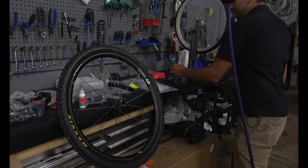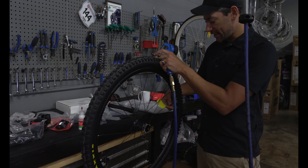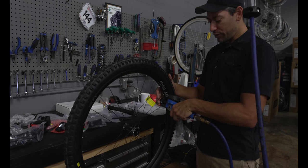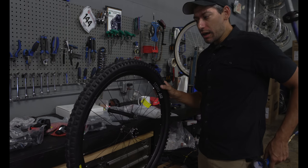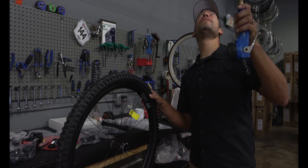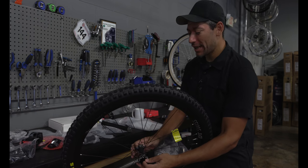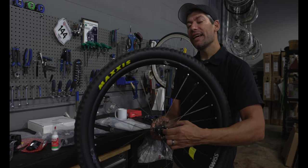And I will probably take this up to about 40 PSI, just so that things settle into place. And we let it sit at 40 for a while? Yep. And then on my first ride, I just go and adjust? Let it down once you go to ride. What do you typically recommend as a loose pressure? Your body weight, your ride apparel and everything, divided by 7. I'm 240, divided by 7, whatever that is. It's mathing. Typically body weight divided by 7 will give you 32 pounds roughly. Nice, 31.5 pounds. And then you can go from there.